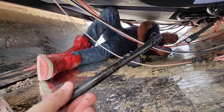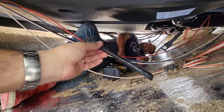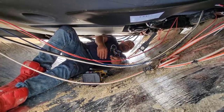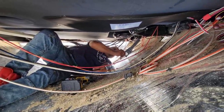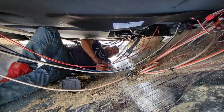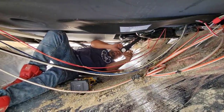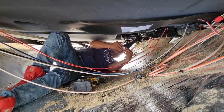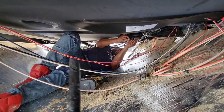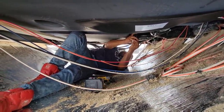The seals still look good — no damage or marks on them. I would put it back, just because that huge thing was putting a damper in it. This is essentially how they blow mold the tank, and it broke off and they never pulled it out of the tank. So this is really an issue with the manufacture of the tank, not necessarily the RV, because there's really no way for them to know that this was stuck in there. At X-Ray RV we try to keep it as low cost as possible for you — if you'd like to replace the valve, we can, but if the valve is still good, let's just go ahead and throw the same one back in.